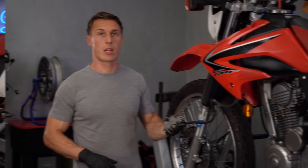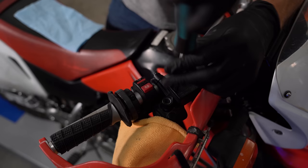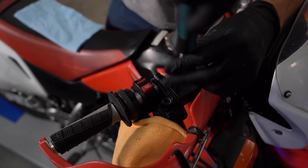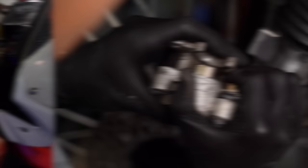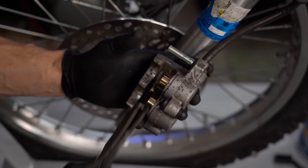The rotor is dressed and the caliper is clean. We are now almost ready to push the pistons back into the caliper body, which you can usually do by hand. Before you start squeezing though, you're going to want to remove the lid from the brake fluid reservoir, since pushing the pistons in is going to force fluid up through the system. Keep an eye on that fluid level, and if it gets too high, you can wick excess fluid off with a paper towel. Pushing the pistons in can be a little like playing whack-a-mole, since pressing one piston in may force another one out. Just work at them slowly until they're seated all the way in.